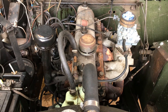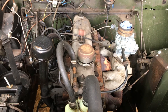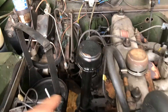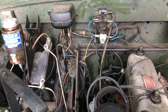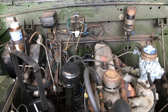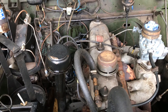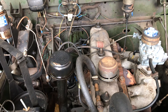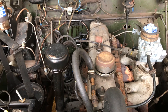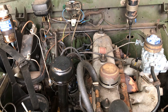Welcome back everyone - we've got some videos coming up on the Land Rover with some engine work needed. I took it out on a long run to a show recently and when I looked in the engine bay the oil filler had been spitting oil - some's gone back on the dizzy cap and the air filter hose as well. Not a lot of oil for three hours driving, but that is crankcase pressure somehow pushing oil back out the filler. I did a compression test and all the cylinders are about 120 dry and 130 wet, so there's nothing serious going on - the head gasket is not split between cylinders and I don't have a big problem in only one cylinder.